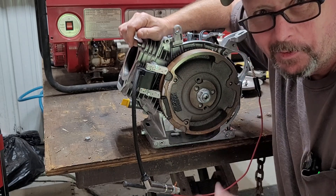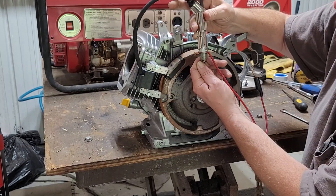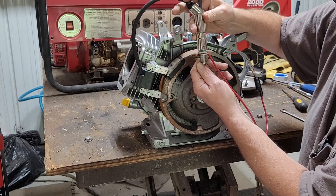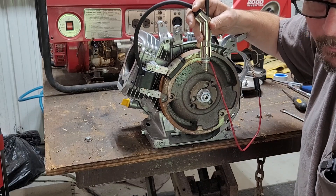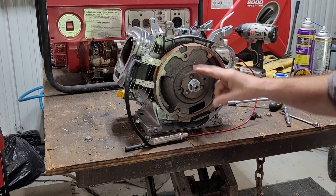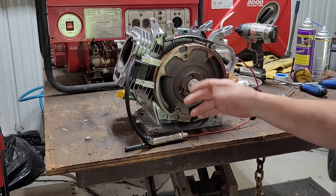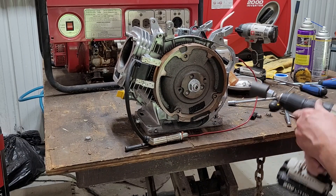I'm liking the pixie theory much better. Let's just see it fire off. Spark's gonna jump to the ground — boom — ignition — boom — we got power, folks. We need that flywheel turning around 250, at least 250, or close to 250 RPMs to get that thing to fire up.